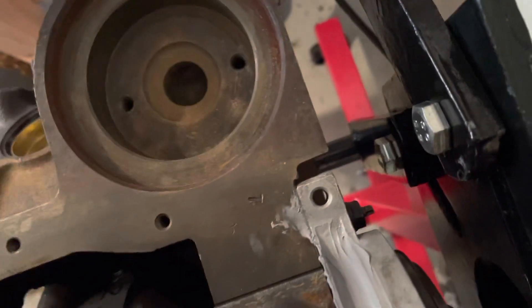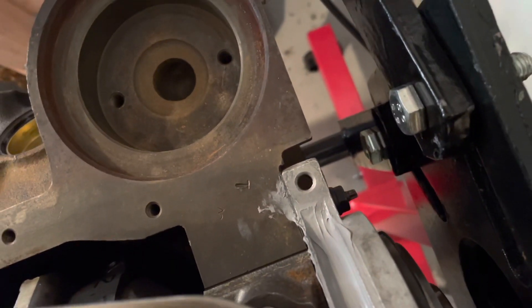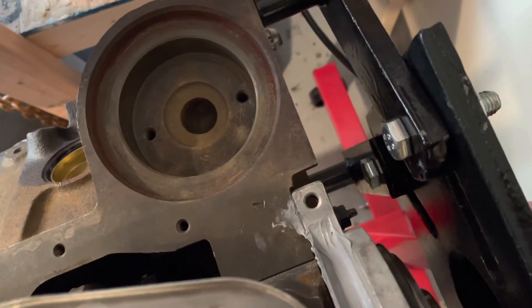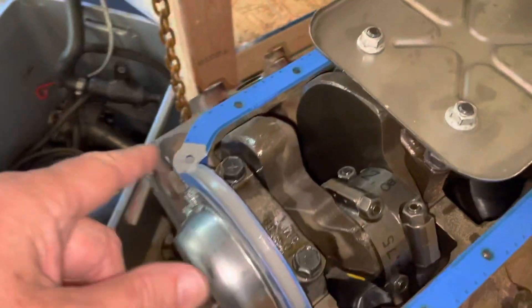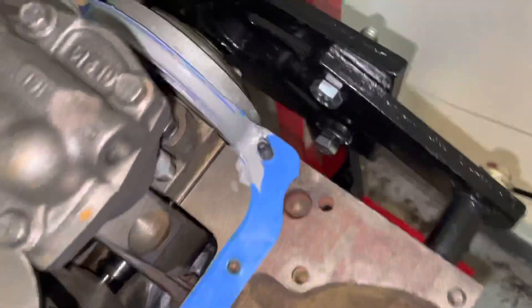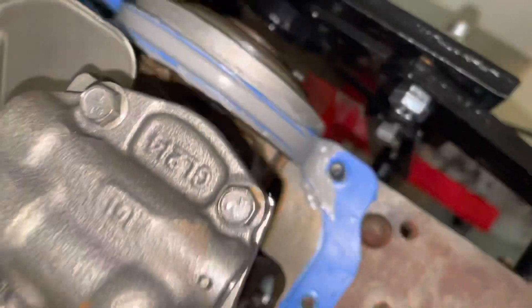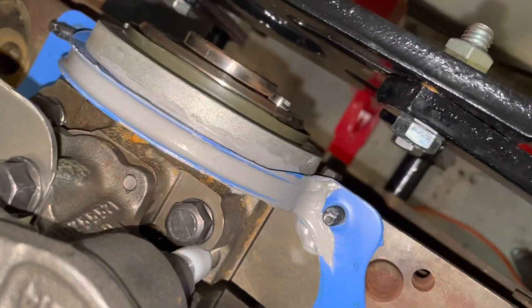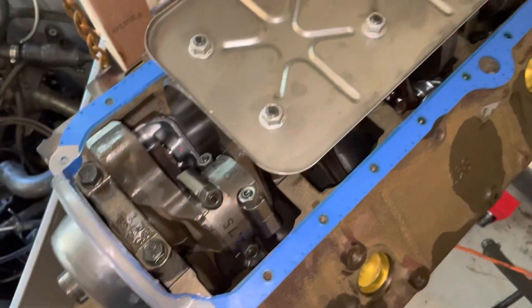Now that I've cut it, I'm going to put the metal stud in that hole right there. I had to take it out in order to cut it with a razor blade. After I put the metal stud in, I then lay the gasket in place. I've now put the silicone in the corners, across the top on both sides — that's the front and on the back, same thing. Silicone in the corners, across the gasket there, and then in the corners again. I'm now about to place the oil pan on the engine and then bolt it down.